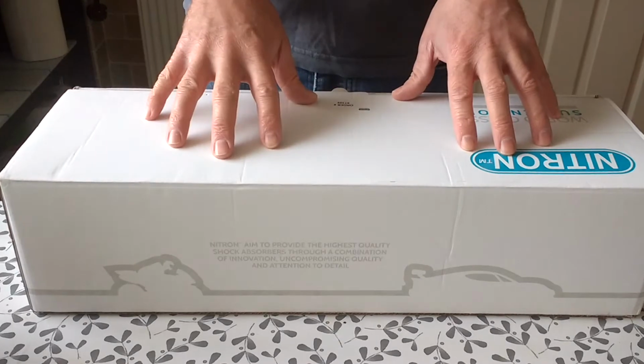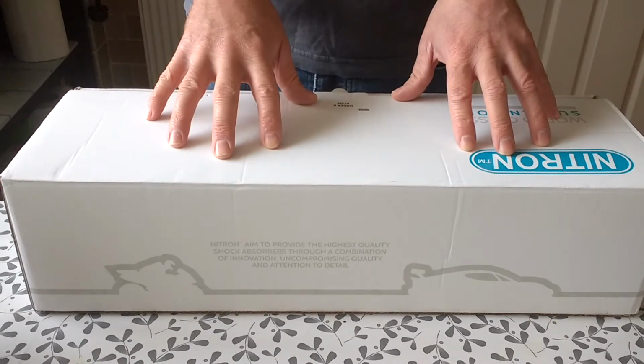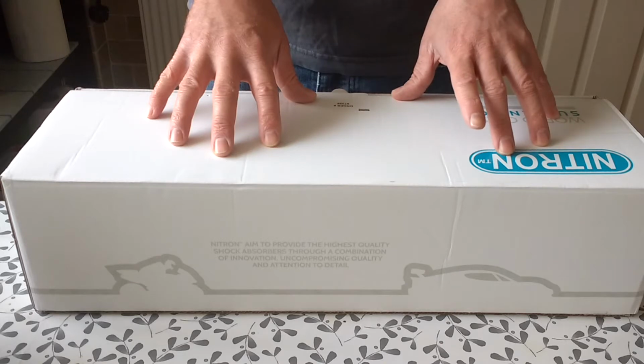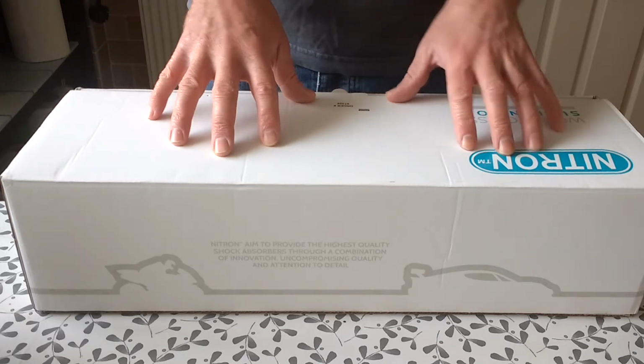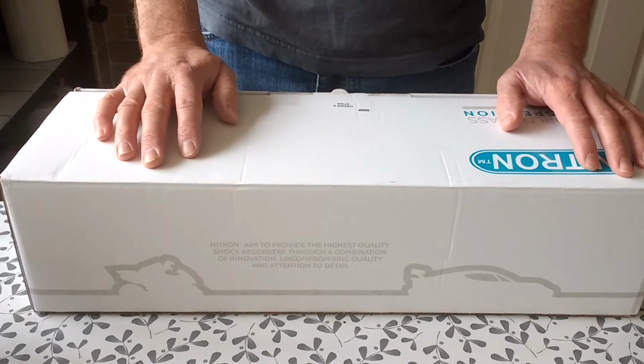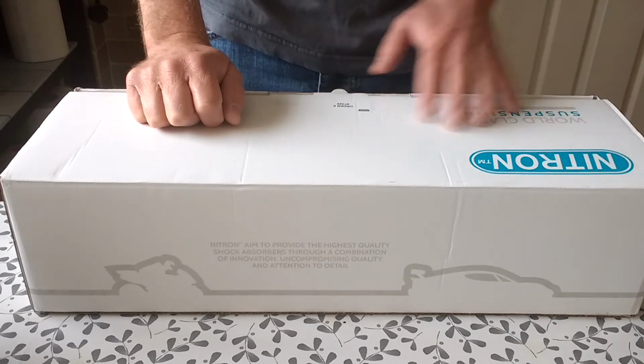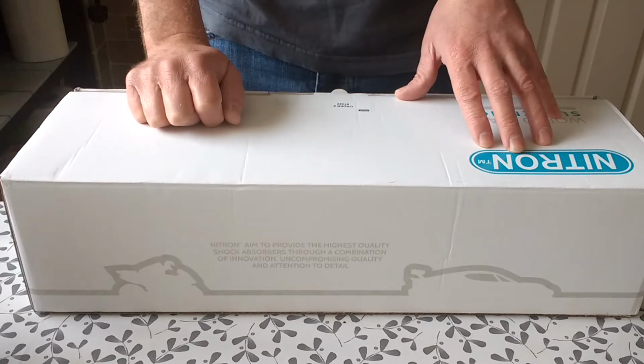The problem I was having with the Yamaha MT10 is the rear suspension feels very harsh, very choppy, very little damping really. I've messed around with the, what's it called? The shock absorber. Yeah, but which bit? No, the springy. No, the other bit, the rebound and the compression damping, really didn't seem to have any effect on it at all. I've messed around with the preload, didn't really do very much.